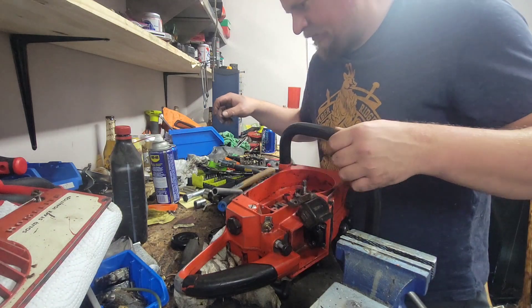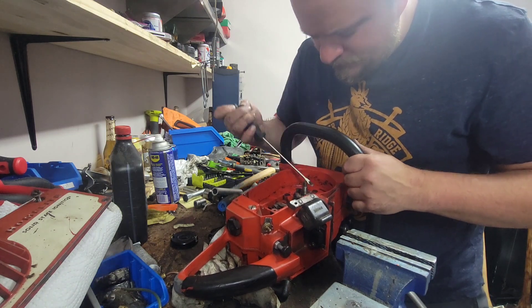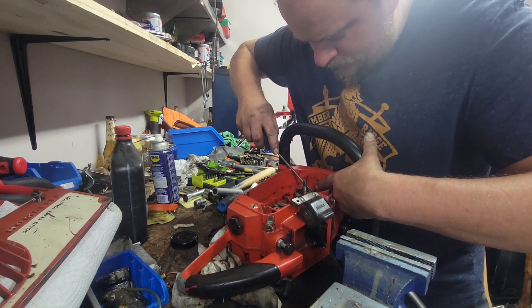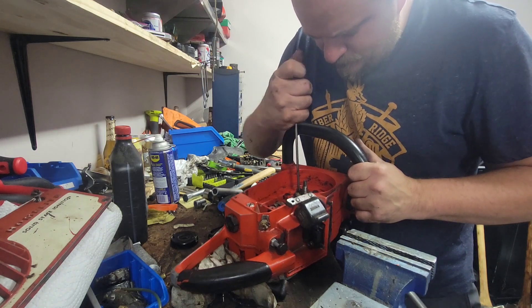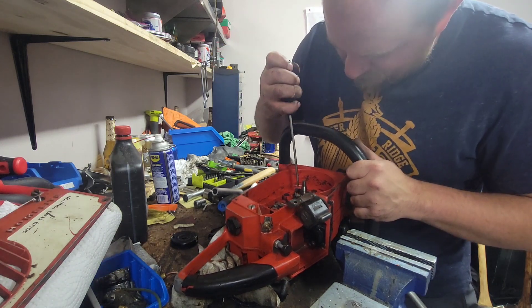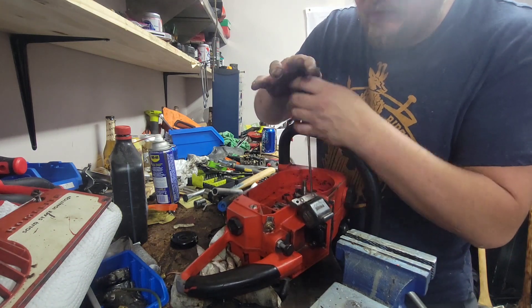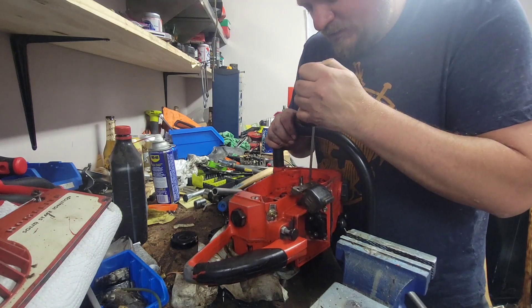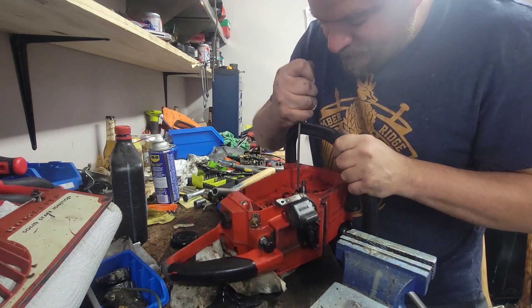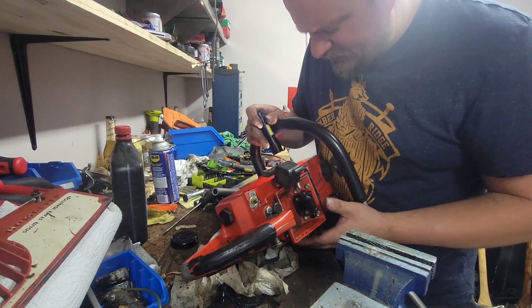I would correct that. I'm not a points guru but I understand them - I know how to work with them. Yeah, that looks better right there. Tighten that down. I'm literally just eyeballing 15 thousandths of an inch, which is essentially half of a 30th - so a 64th I guess. Can you eyeball that? Yeah, you can. I eyeball crap at work all the time, usually working within a 30th at work.